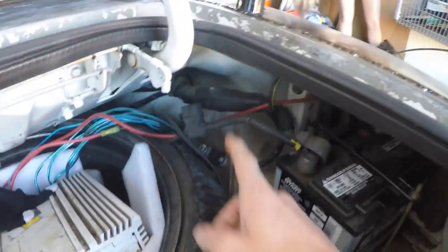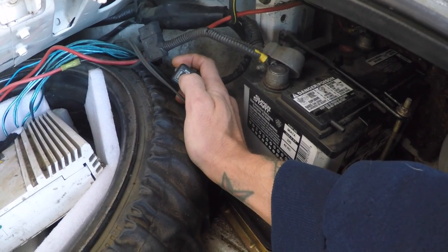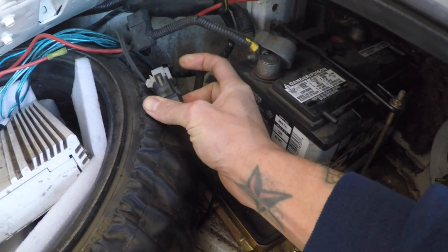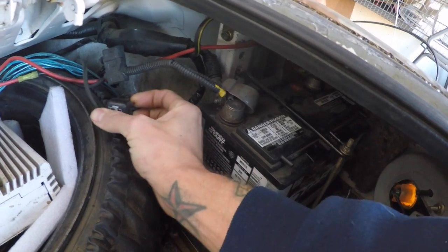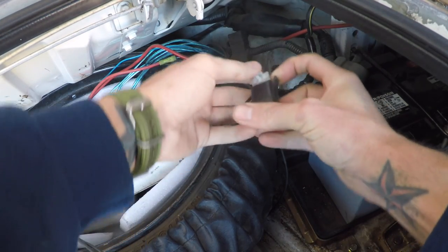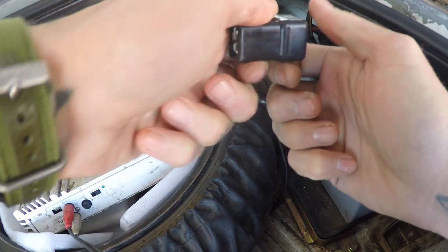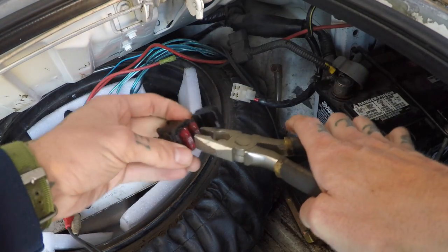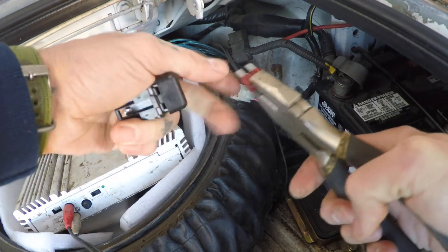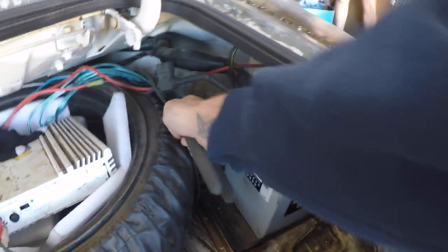So you need the switch for the dash, this relay, and then if you have a power antenna there should already be an antenna fuse. There's also a defog fuse — 10 amp. Make sure you have this connector; it plugs right in next to the battery. If you don't have it you can buy it. Once you find that plug, verify it actually has a fuse in it. Open it up and verify that you not only have both fuses but that they're not blown, because that would be a pain trying to figure out why it's not working. Check it first, then close it up and tuck it back out of the way.